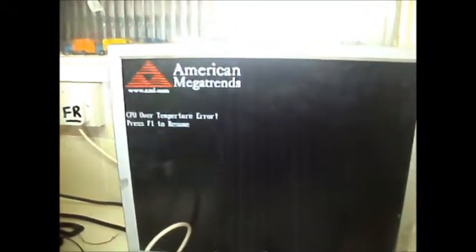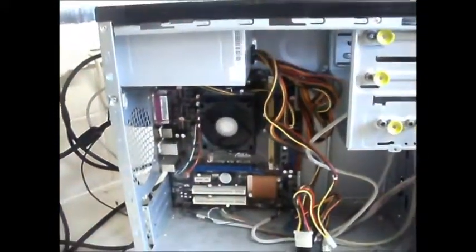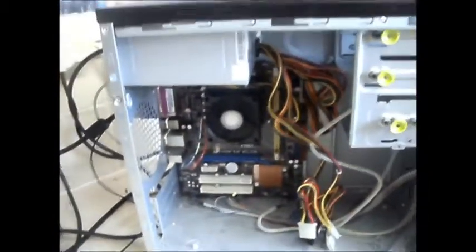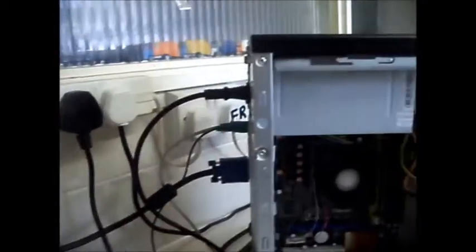I'm back with this one for a minute, because stupid me didn't have the monitor cable plugged in properly. The screen says CPU over-temperature error — that's what that beep was about. So that might be as simple as putting some fresh thermal paste on it. That'll be one to investigate in a future video. I didn't plug the VGA cable in properly, or it fell out when I moved the case around.